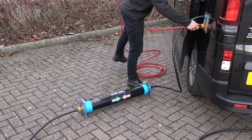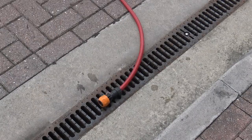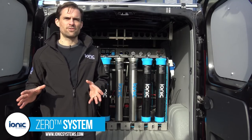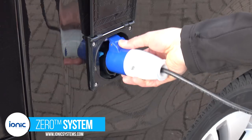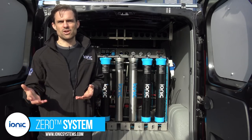With the mains water connected, add a length of hose to the reject water connection and run it to a nearby drain. Ensure that none of the hoses are kinked and that the water supply is not interrupted during the fill process. Next you can connect up the mains electric supply — use an RCD protected supply for this. Always route cables and hoses so there's not a trip hazard.